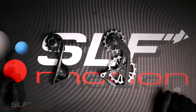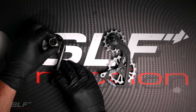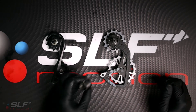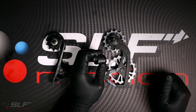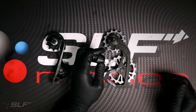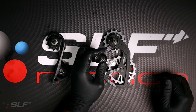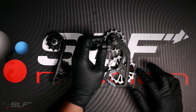With your stock cage removed, we are now ready to prep your Evo system for installation. Remove the stock spring and dust shield and move it over to the Evo system. For this model we offer three spring tension settings: low, middle, and high. Low is going to provide you the least friction but high is going to provide you the best shifting. You decide what you're after — we recommend starting in the middle position.